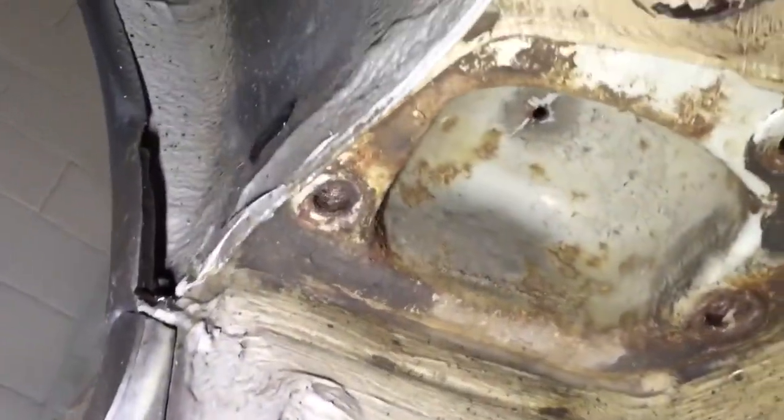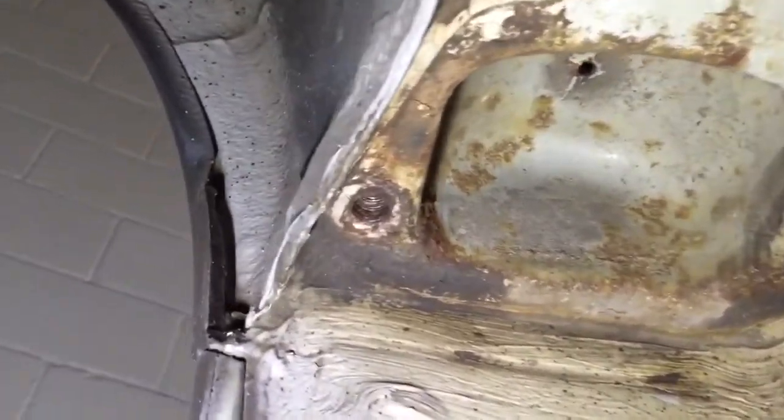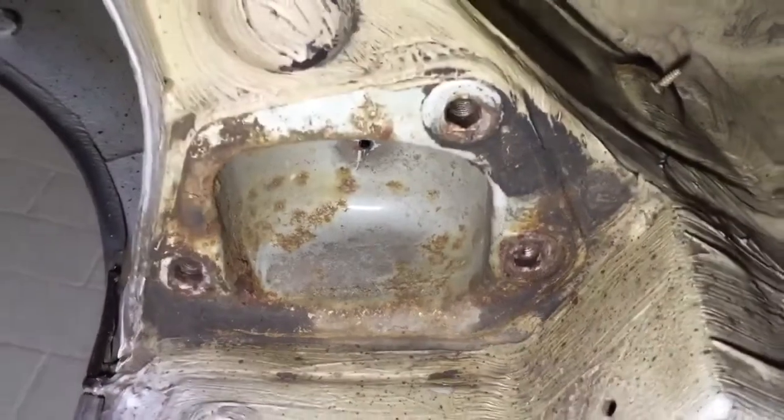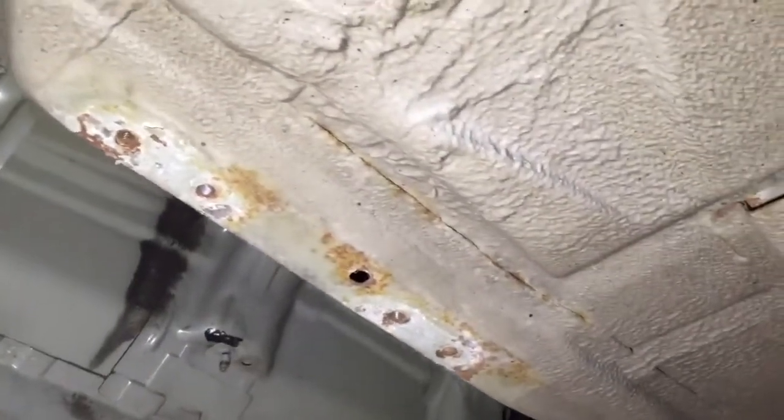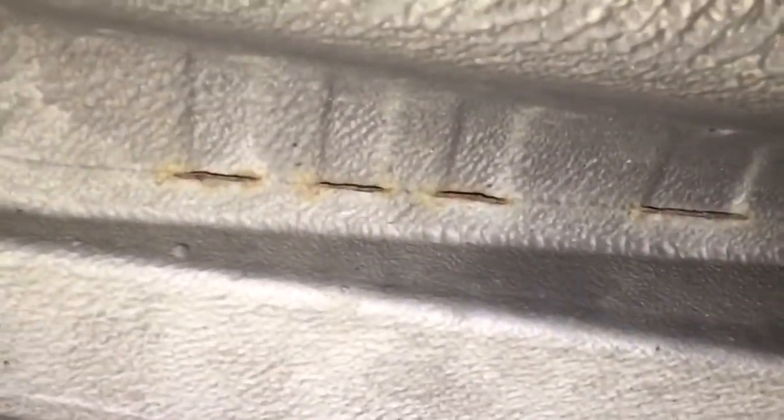You've got some around the corners where the bumpers join, because you've done a little bit of protecting work already, which is good. So that's what the rear trailing arm pockets look like. The only other area that's all surface is where that's a chassis leg support, and that's the main chassis leg. The sealer's starting to split and a bit of corrosion coming in where the panel joins.